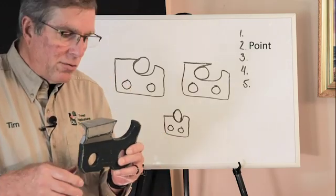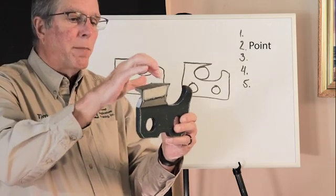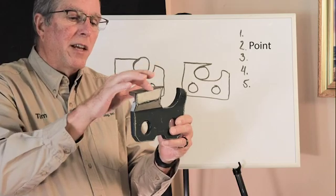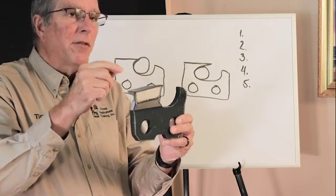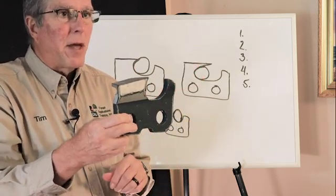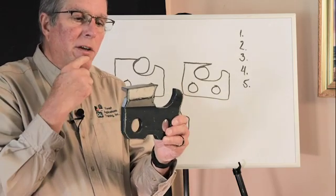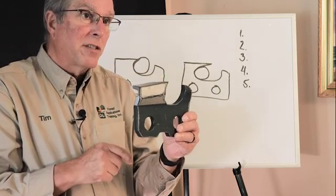Now, going back to cutting crooked, if you look from this point back to the back, the problem is that it goes downhill. And so as we sharpen or grind this back, the point gets lower. And when that happens, it's going to raise the depth gauge. So we need to make sure that we understand that. Think through the process of how it has to be adjusted.